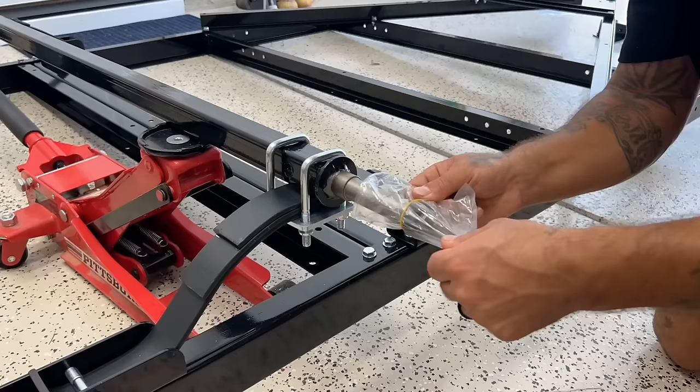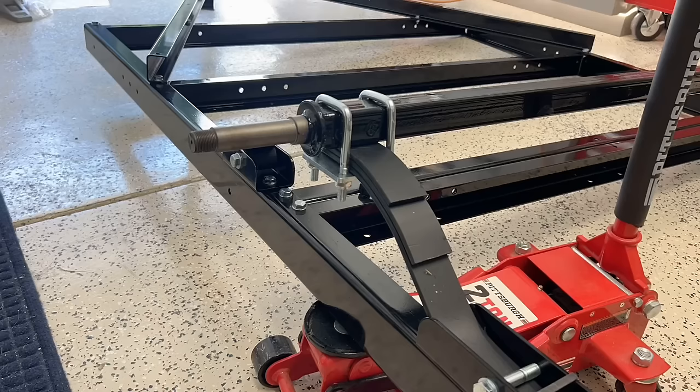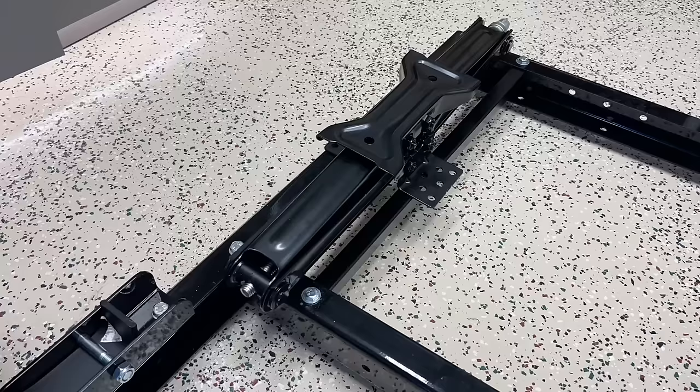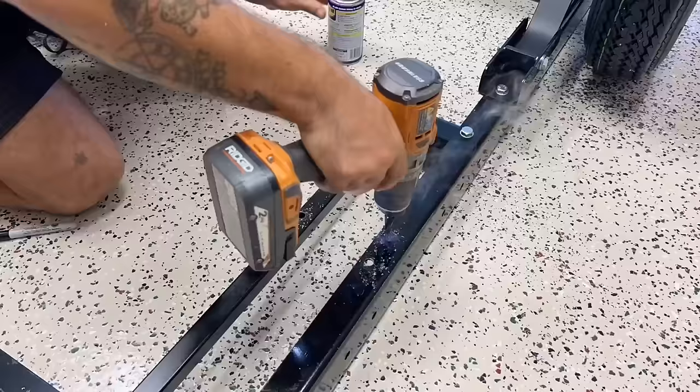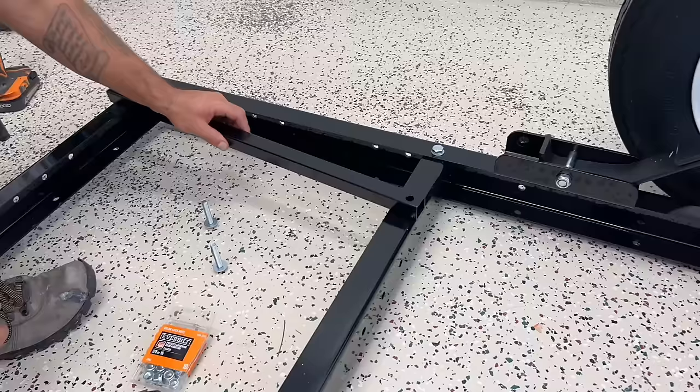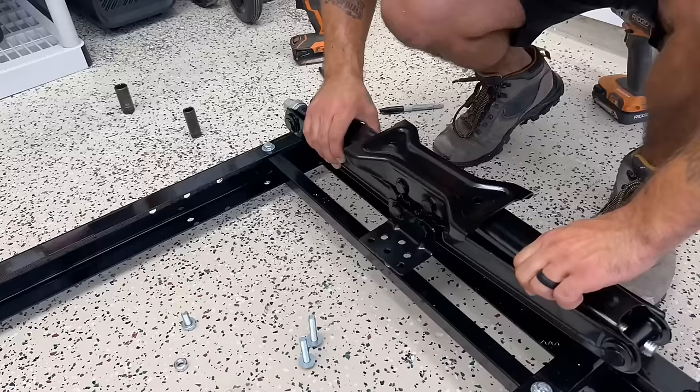While the paint dried I installed the wheels temporarily, because we plan on getting bigger ones that can handle tougher terrains and are rated for a higher speed. Once the paint was dry I installed the brackets onto the trailer using lock nuts, bolts, washers, and even Loctite to make sure the jacks don't rattle off on the interstate. Adding jacks to each corner is complete overkill, but I plan on selling this camper and wanted as many cool options as possible.